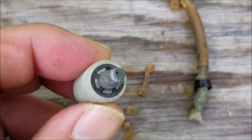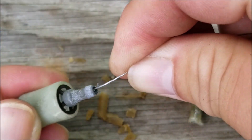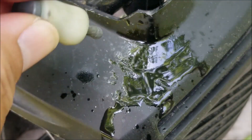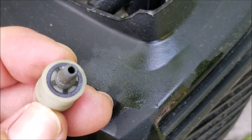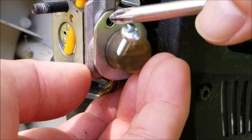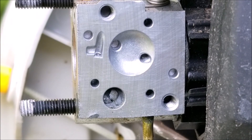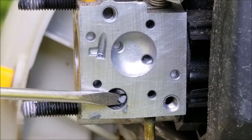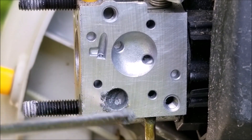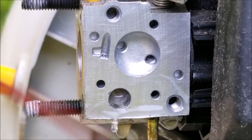After removing the original fuel filter from the line, it looks like it's in good shape. However, if you look where the fuel line goes, you can see there's corrosion inside it. After removing the primer bulb side of the carburetor, I can see the internal screen, which is completely covered with the same gray buildup that was inside the filter. A clogged screen reduces the amount of fuel the carburetor can deliver to the engine, so it's a good thing we didn't try adjusting for more fuel. I'll clean the screen and the primer side of the carburetor, then reassemble it.